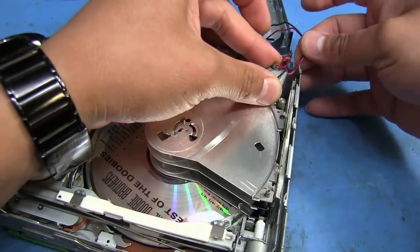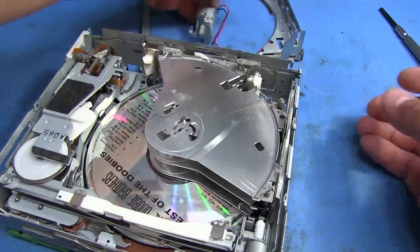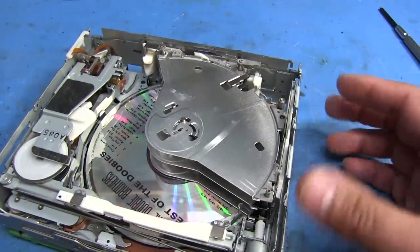I'm going ahead and removing these screws, and now this motor should just be able to be pulled right out — like that. We've got to remove this wire from this little loop here, otherwise it's not going to release. So this whole top assembly you can just set off to the side — we don't really need to mess with anything on that.